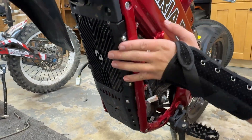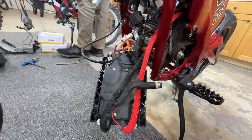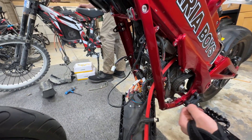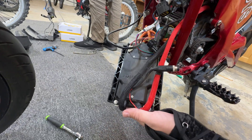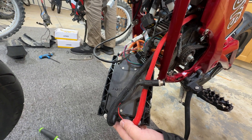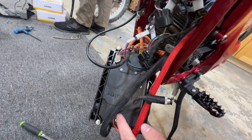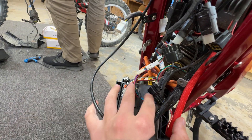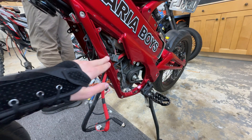Next steps: we're taking off the fender, the horn cover, the skid plate, then the controller. We got the fender off, horn cover off, skid plate off, controller halfway off. We're actually going to be switching our nuclear controller to an X9000 controller just for this video to get full potential out of this battery and motor — this controller only does 500 phase amps. We'll take off our two power wires, the three motor wires, and then unplug the rest of the wires.